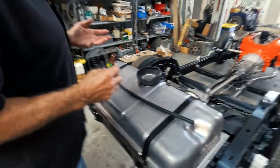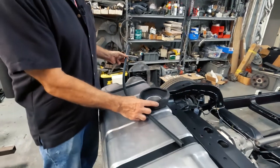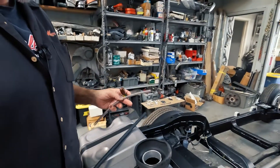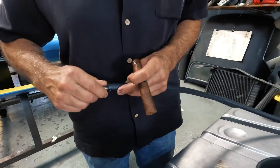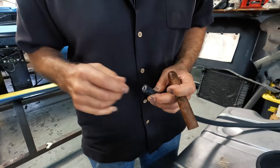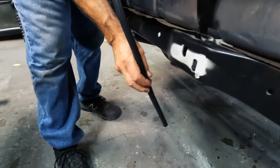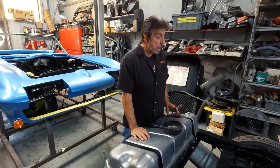A lot of people aren't going to know this, but I'm going to show it to you anyway. This is the overflow hose for your gas tank — you're putting the gas in, sometimes a little bit too much, and it goes into this little rubber and out the bottom. They put this spring in here, which most people don't know about, but they check for that when judging these cars. What it does is prevent kinking, because this hose goes on here and comes down and attaches to one of the bumpers. I put it on now because it's really a pain in the neck to pull back off and put back on later.